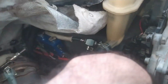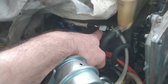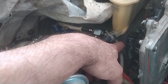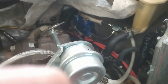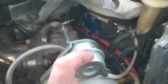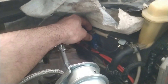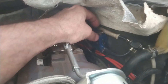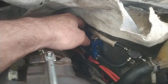What the controller does is: boost coming through here, instead of going into the internal wastegate, it leaks from here. The more it leaks, the less boost goes to the wastegate, so the wastegate won't open and more boost will build. If you don't want to build more boost, you set it to a lower setting or close it — clockwise builds boost, counterclockwise turns boost down.